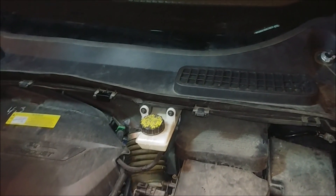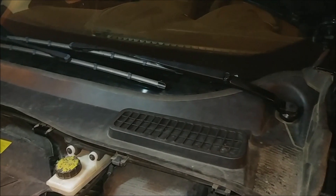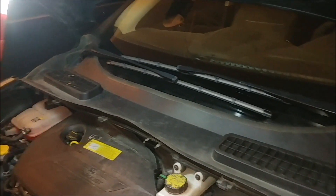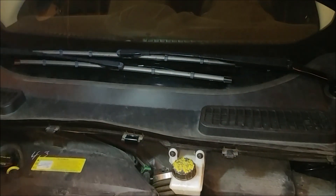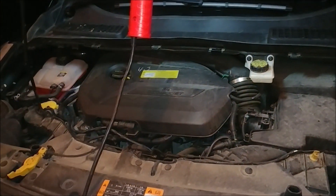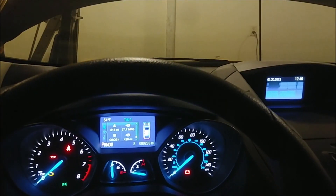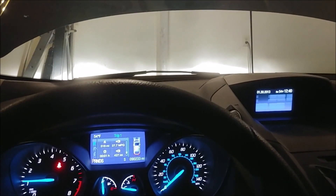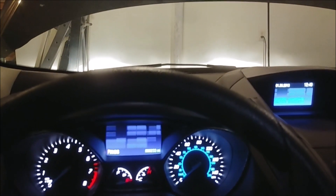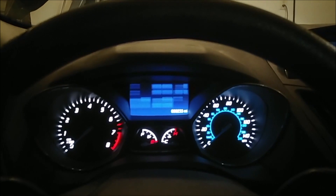All that's left is putting the windshield wipers back on and then we're done. I think I have the windshield wipers back where they were before. They are actually not keyed — it's just splined. So I'm going to go test them, and if they're off a little bit I can readjust them because they park down underneath and then move up when they're actually running. Windshield wiper test — and did they park? Yep, I think we're good. I think this is a successful repair. I just got to reset my clock and all my radio stations. Successful. Thanks for watching. Bye.